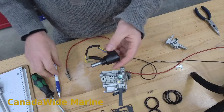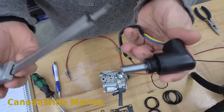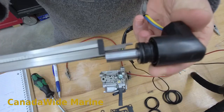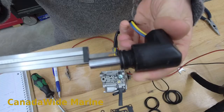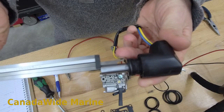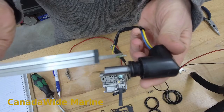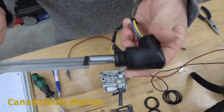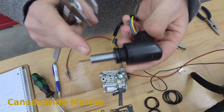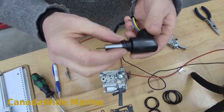Now that we've generated some sparks and warmed it all up, I'm going to zoom in here and show you the difference in the height. You can see right there — it's a little bit blurry — but you can see that gap there. When we measure this, it's about one and a half millimeters longer now. So it has expanded, closed off your air, closed off your fuel. This valve still works 20 years later.